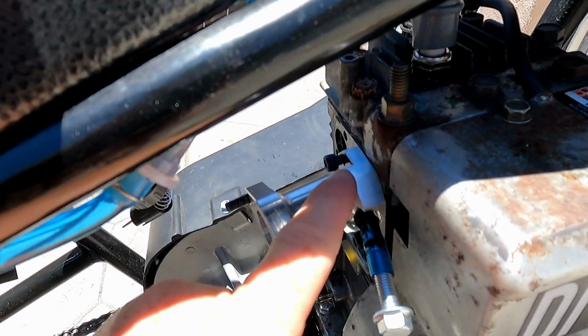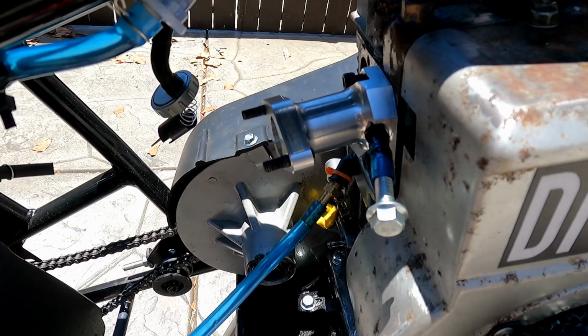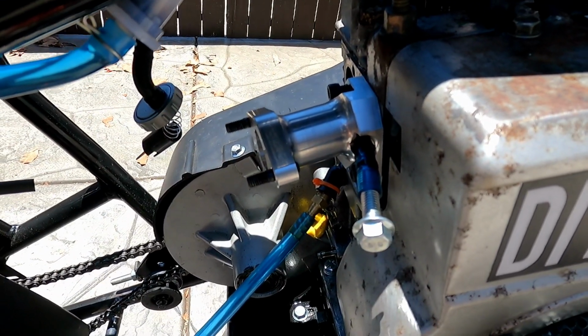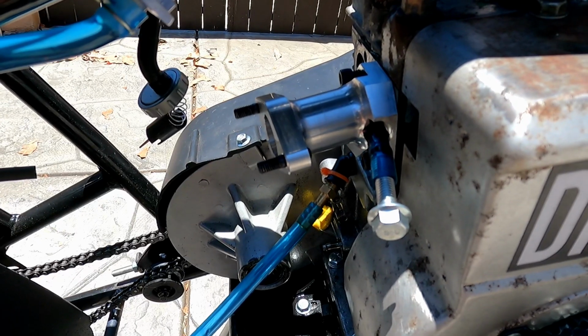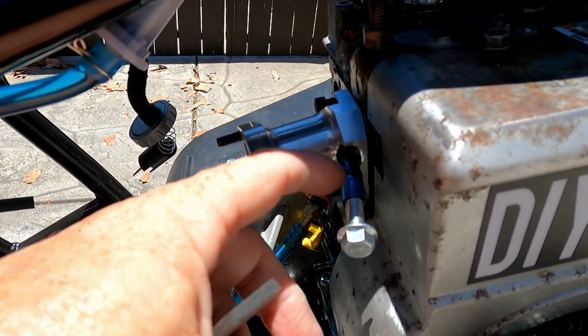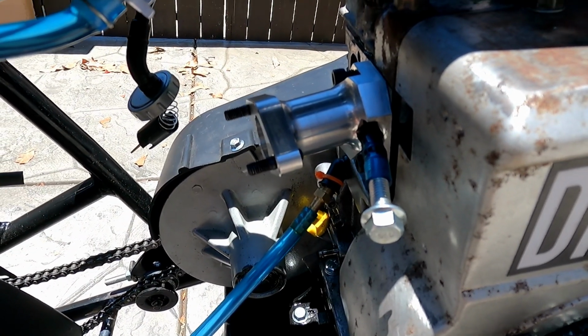So I was getting a massive air leak along the top right there. I hope that's the problem. I think I'm going to make a little spacer for this bolt so it doesn't bottom out so fast, and hopefully can apply some pressure to the intake. And I'll probably get a shorter bolt. I can buy those bolts. Also, I'm going to get a plug for this to get rid of this. It's just temporary for testing purposes only.